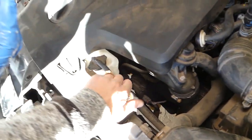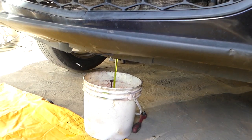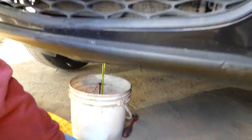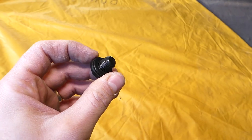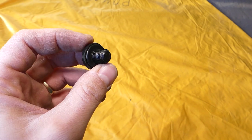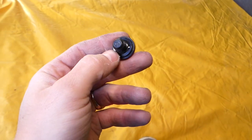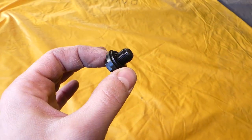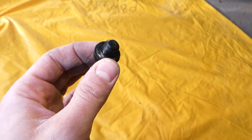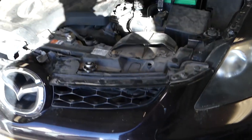Open the radiator cap and more coolant will start coming out — pretty fast. This is the coolant drain plug; it's plastic so you have to be careful getting it tight. There is a rubber seal here that you need to inspect before putting it back together. Always check that because otherwise you can develop a coolant leak and that could eventually overheat your car.